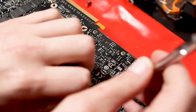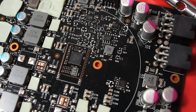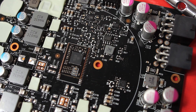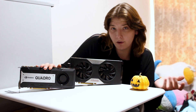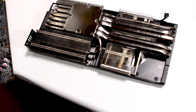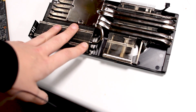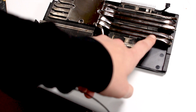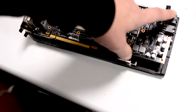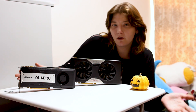After this, I was running into both thermal and power limitations. So I took the card apart, took off the cooler, and did a shunt resistor mod on the card — the same sort of mod you would do on any 7, 9, or 10 series GPU. In this case it's super easy; I just put some solder across the three shunt resistors. Naturally, because the power limit was gone and we're overvolting and overclocking the core, we ran into a thermal limitation. So I had an extra 780 Ti air cooler, held it up against the card, and it fit well. I had to take off some fins on the rear of the cooler because the power connectors are oriented differently on Quadro cards versus GeForce cards. Once that was mounted, everything was perfectly fine — thermals completely under control, no problems whatsoever.